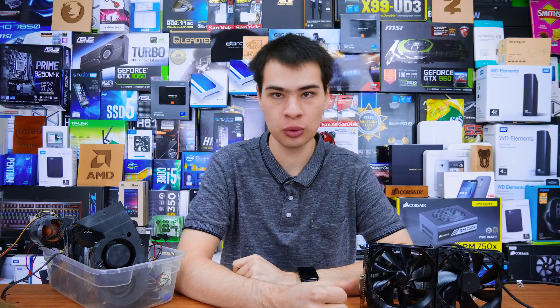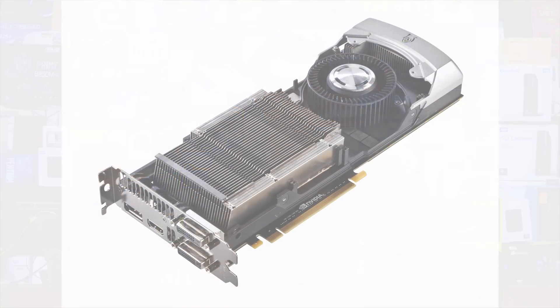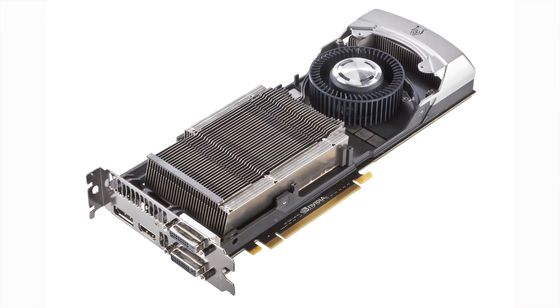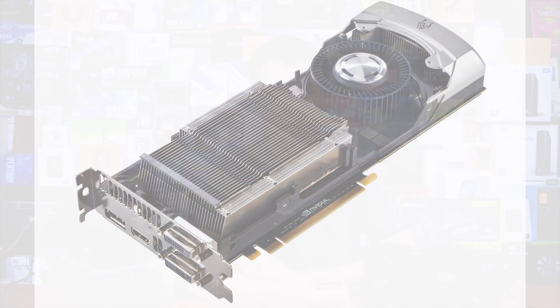One more thing I want to point out before we get into the tests: this card is and still is an open shroud type cooler. Now if you do have a blower style card, you would technically see less success than what we experience here today, because blower cards generally have a much smaller area when it comes to the fin array. There's definitely enough fin array to keep it cool, but compared to an open shroud fin array, there is a lot more surface area, and surface area is definitely key for cooling down your video card. So if you do have a blower style cooler, I recommend just going on eBay and picking up a brand new blower fan and sticking that in — you're going to see a lot better performance than strapping a big fan to it.